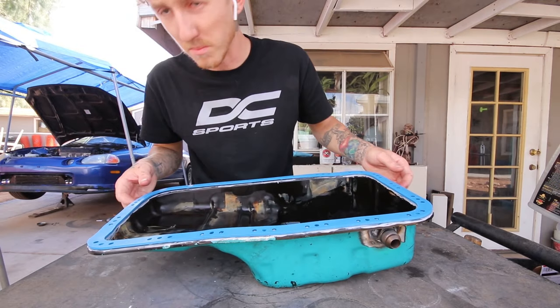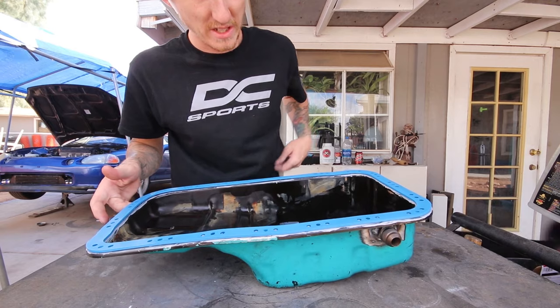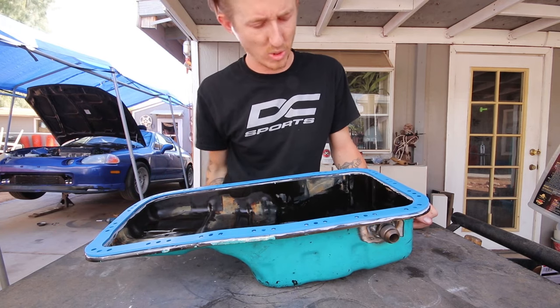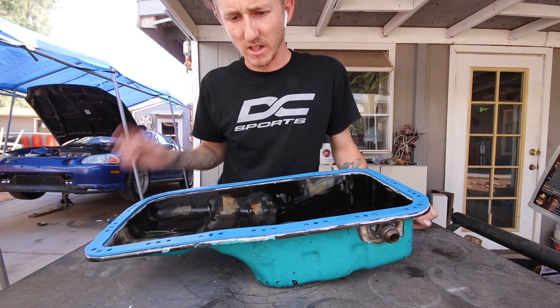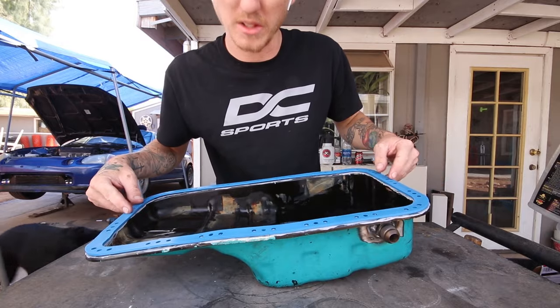All right, so it's pretty much on there. Honda Bond will help hold it in place a little bit. And I'll just go bolt it back up, and you want to hand tighten it and then leave it for a little bit and then go up and torque it. And the torque is really low. I forget, I have to look up the specs, but I just know to do it hand tight in a crosshatch pattern, and then come back a little bit later and finish it.